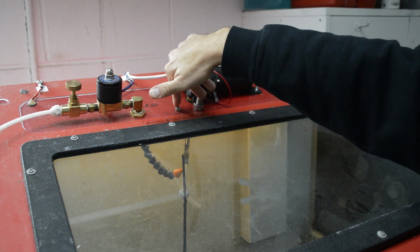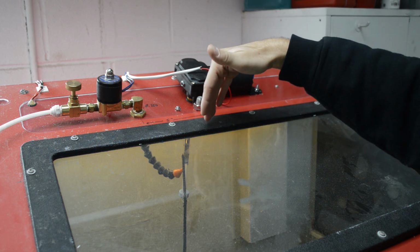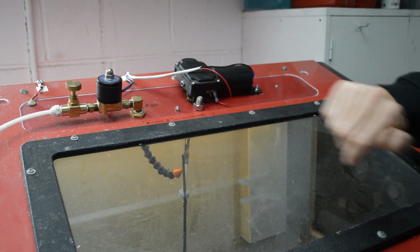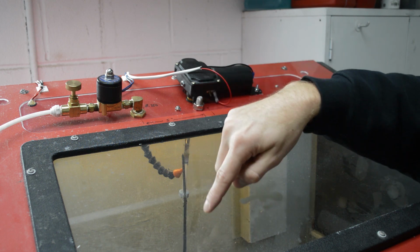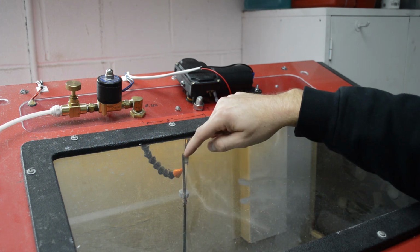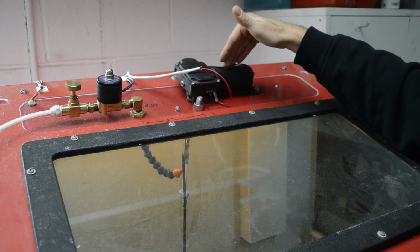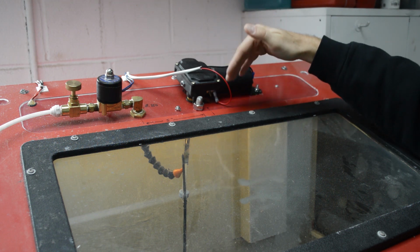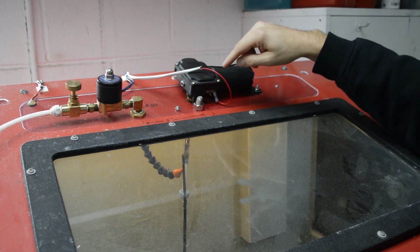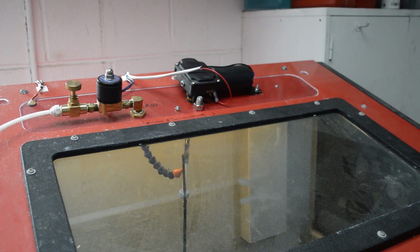The old one mounted here, so you see I just put some bolts in here with some silicone, and then I remounted it up. Got the new wiper arm, which is adjustable, and I'm running the same blade that came with that junky wiper motor. And these replacements are available. They're like $8 or something like that. But anyway, this is like $110 for this motor. It has a high and low speed. It also has park. Park I'm not concerned about. You can buy a high-low switch, but I just have it on low, and it works just fine.